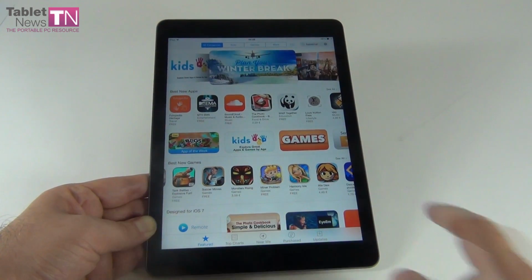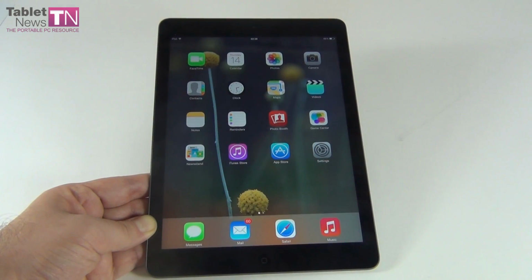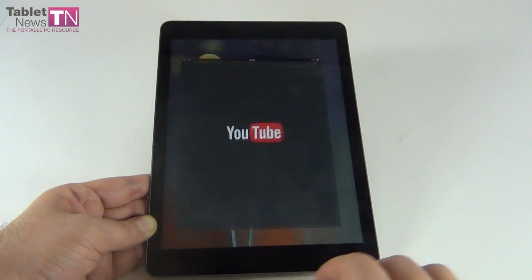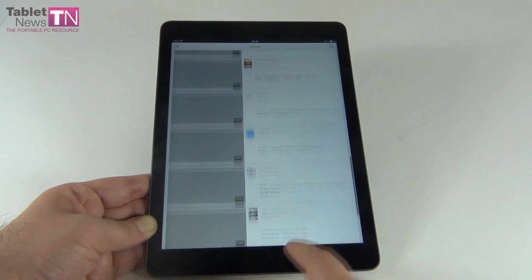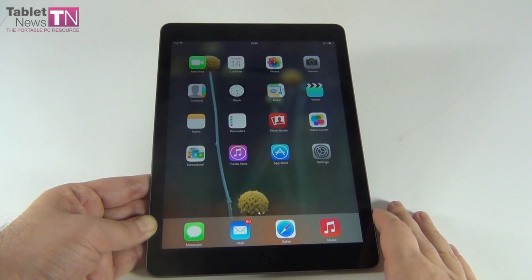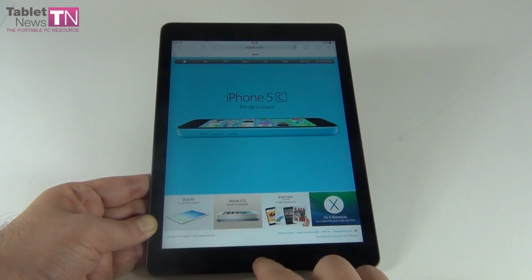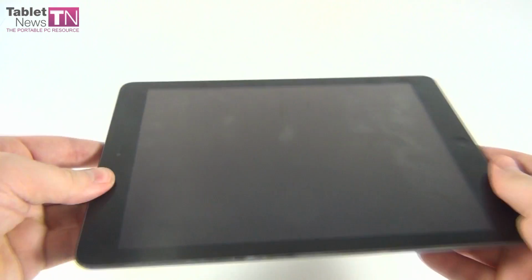This one is a 64-bit processor with a clock speed of 1.4 GHz, which is 100 MHz more than the processor on the iPhone 5s. We got Cyclone cores here on this device and also the M7 coprocessor for movements analysis. The GPU inside the tablet is a PowerVR G6430, and other features here include 1 GB of RAM, 16 GB up to 128 GB of storage, and two cameras. So we have a 5 megapixel camera at the back and a 1.2 megapixel camera right here at the front side.